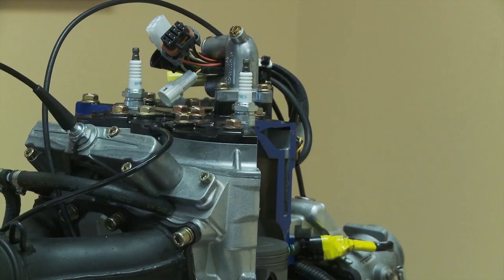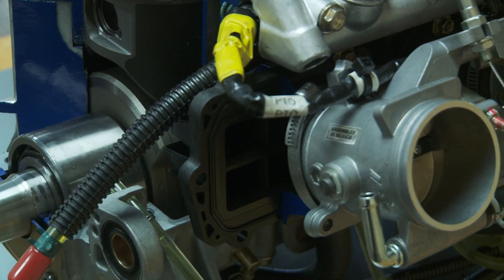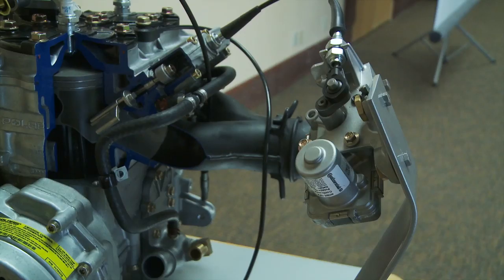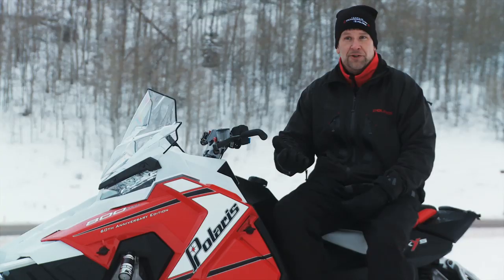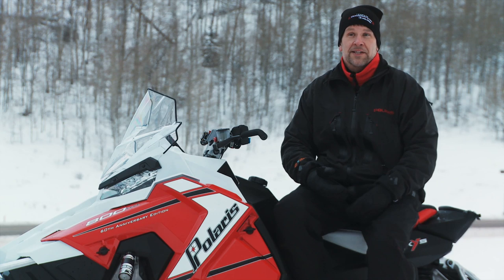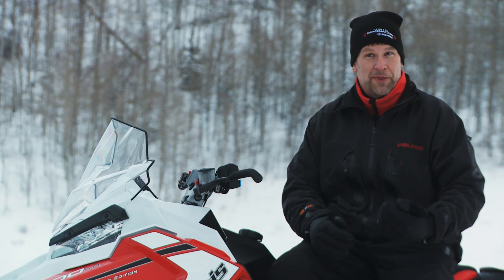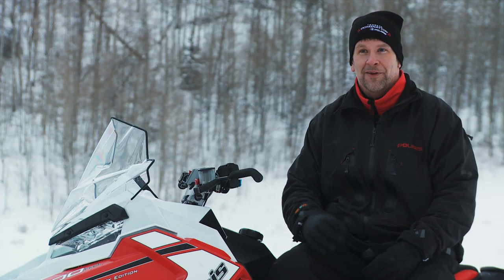The motor itself has a few key changes. The big one is three-position electronic exhaust valves, which improve performance, fuel mileage, and running quality. We also put in a lightweight crankshaft that's two and a half pounds lighter, allowing the motor to rev up quicker and helping overall performance. Additionally, an electronic oil pump gives you a lighter feel on the throttle and always delivers the right amount of oil to the engine. You're going to see a huge improvement in performance — more horsepower, stronger running, and quicker revving throughout the power band.